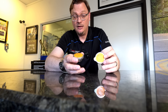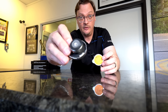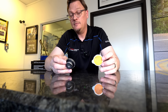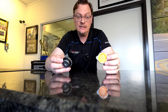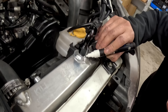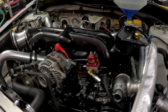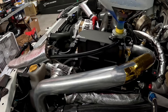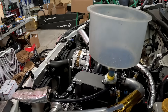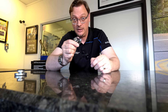Virtually every aftermarket cap is a two-way cap, not a one-way cap, which again you can tell by looking at the back. So what about all these higher pressure caps? If you're running water as a coolant, you need higher pressure so that you can increase the cooling capacity of the system. This is why we ended up removing the cap from our radiator. If you want to play around with pressure and increasing pressure in the cooling system, you really have to go to a single-cap system. You can only start playing with different pressure caps if you have a single cap — a single variable to control — because it has to be the two-way cap.